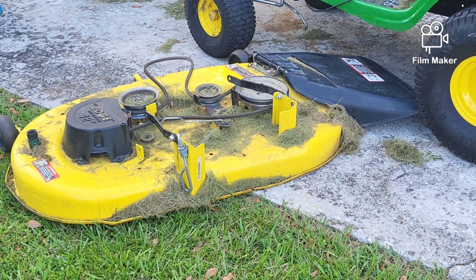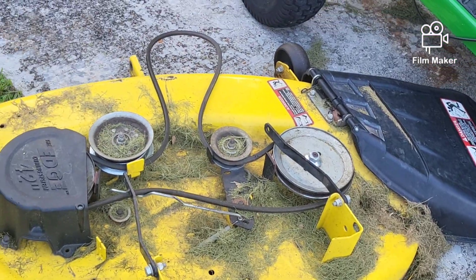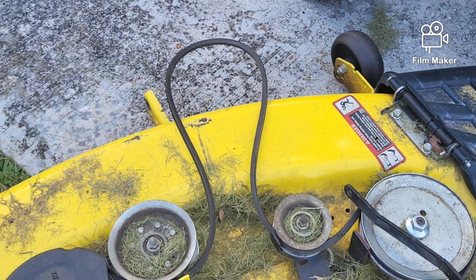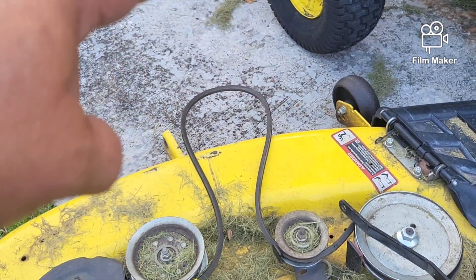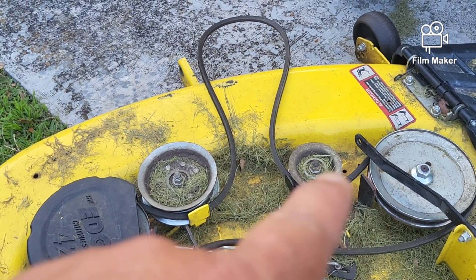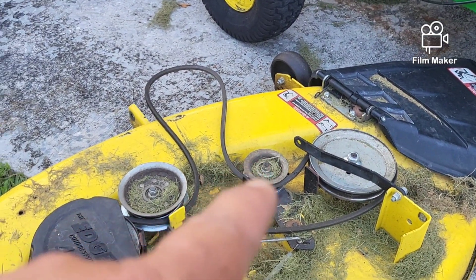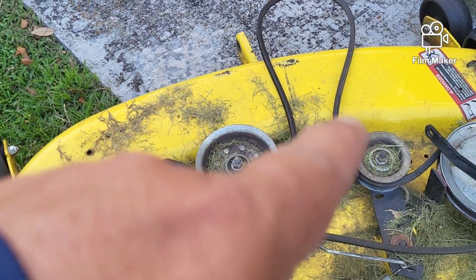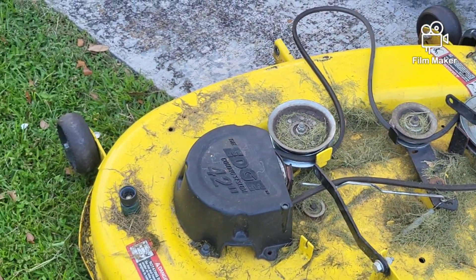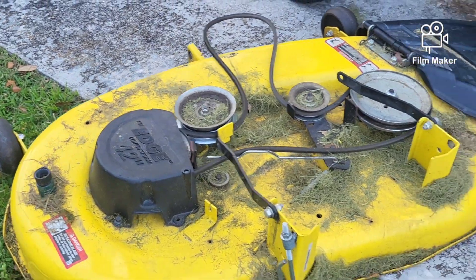We have to change the drive belt as well, which will be on the next video. But most of these machines have a very simple setup — it's like cock and balls. The drive pulley is always in the front of the deck, goes up around the drive pulley, comes down and around both of these idler pulleys. This one happens to be the one that's spring-loaded that puts tension on it when you turn on the blades. When you pull that cable it puts tension on that belt and makes those blades turn. Once it comes down the bottom side, it just goes around the outside, straight across, and straight back around. So if you needed the belt diagram on a John Deere E130, or just about any other tractor with a single belt on your blade deck, there you are.